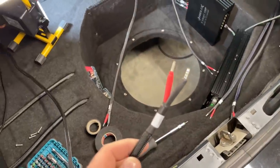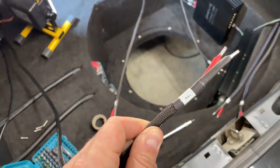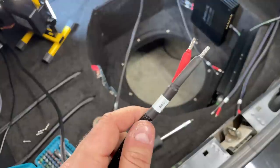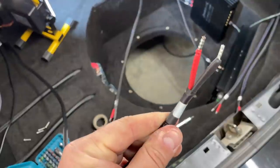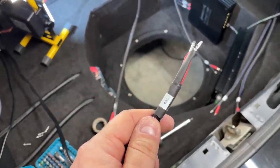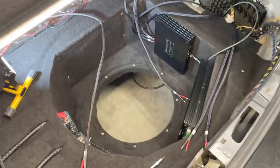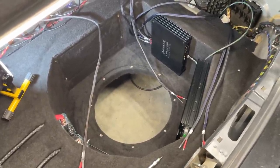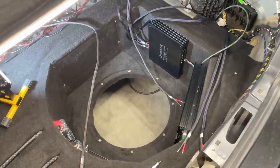You know, sources. Proper termination with ferrules, protected with heat shrink, labeled. So now the front sub is sub left. We need new labels. People always ask me, Pete, where do you get these labels from? Wraparound type things. Well, from a cable factory. Sorry, I can't share that with you. But if you buy one of those printing tools in any of the tool stations, you can just print your labels that easy. Put clear heat shrink over it, things like that.